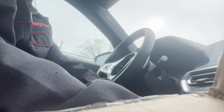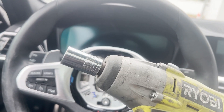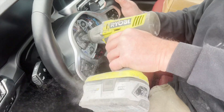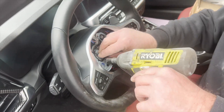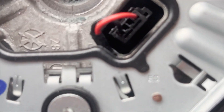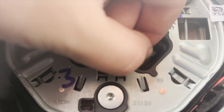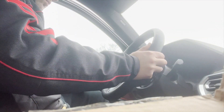When it's off, you'll have to get yourself a heavy-duty impact gun, as well as a 16-millimeter socket to remove the main bolt. This is a body shop impact gun. After the bolt is off, now you have two more electrical connections that you have to remove — one on the top and one with the red and black wire. Both of these are just pullable connections, so you don't have to use anything else. You just grab onto it and carefully pull and they're gonna slide out. After that, you can remove the steering wheel itself.